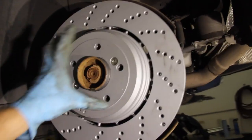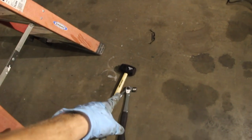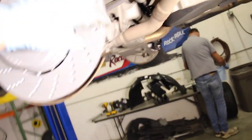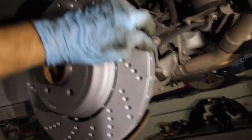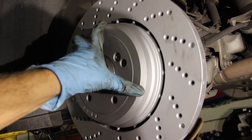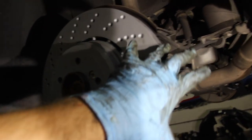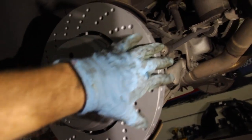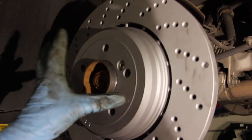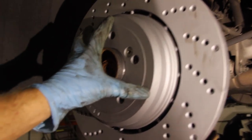Turn the parking brake off. Make sure that it's safe to do so - obviously if your rear axle's in the air, you'll be fine. I still had to use a combination of my 16-ounce mallet and an actual hammer, with probably 15 or 20 blows of a lot of force to get these things off. I left one set screw in a little bit because I didn't want that thing flying off the car - so put one set screw in halfway if you have to hit it really hard with a hammer. And then the new one slid on fairly easily. I put Never-Seize again on the bearing assembly.